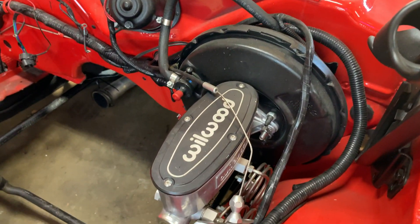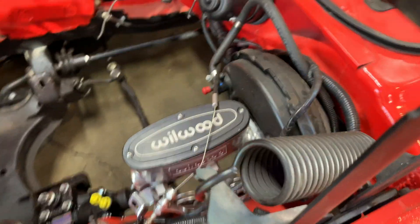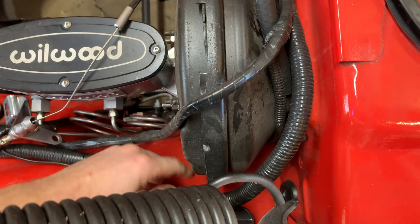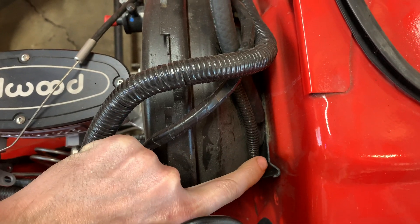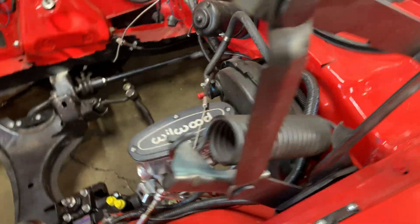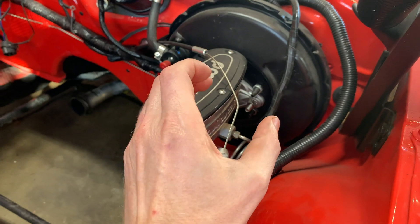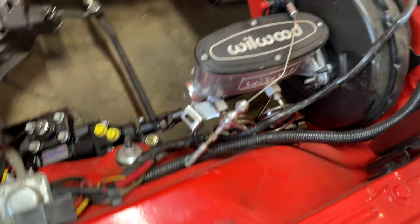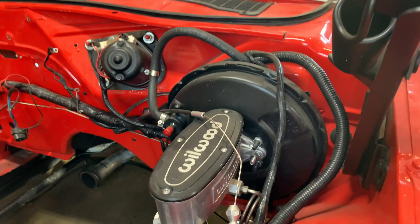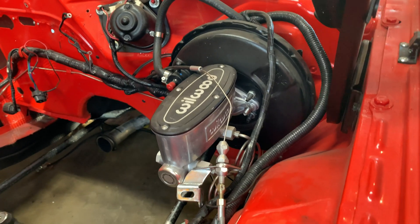The other thing I've got to work on is the braking system, and in particular I've got to figure out this clutch pedal placement. I have a bigger brake booster — this is the nine-inch brake booster — and it interferes with where I want to place the clutch master cylinder. As it stands, the master cylinder is going to land somewhere near the bottom corner and it's just going to hit that brake booster. They do make smaller brake boosters — there's a dual brake booster option that shouldn't sacrifice too much braking power but will make it a smaller diameter and push it forward a little, which is fine because I have room there.